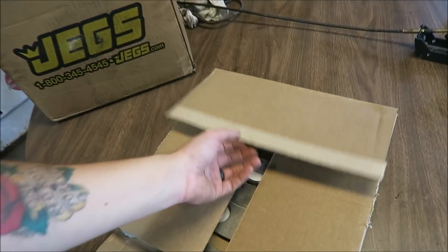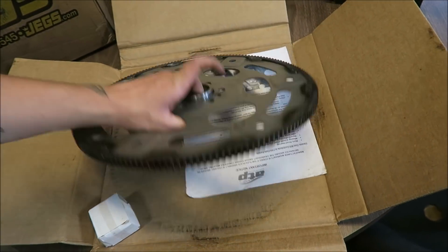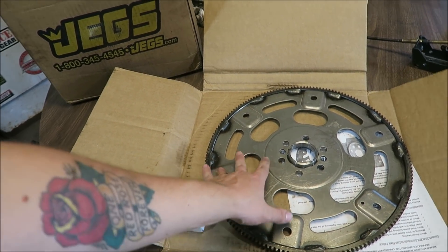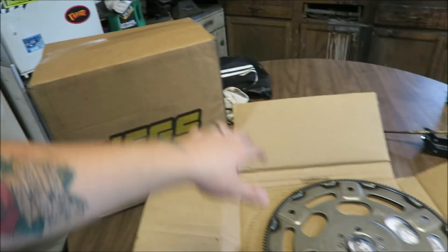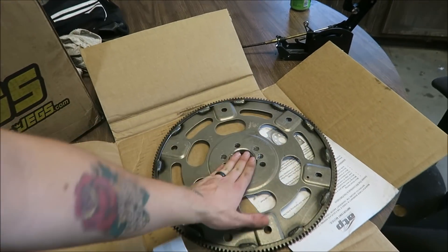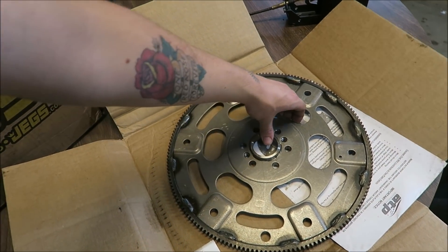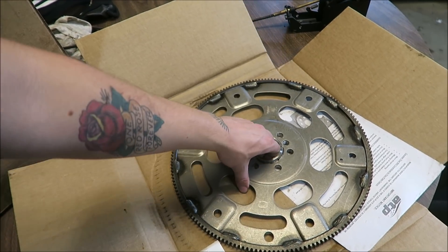Here is the magic sauce for all of it. You can mess around with spacers and expensive advanced adapters conversion flex plates for 180 bucks, but what my buddy Scott told me is: get a flex plate for a 2003 or so GMC Savanna van with the 6.0. They're like 60 bucks, they have the built-in spacer, this one came with the bolts, and it's drilled for Turbo 350 and Turbo 400 bolt spacing — it'll bolt right up. It's the same thing I did on the RX-7 and the LS-swapped Camaro. They're super cheap — I'll try to remember to put the link in the description, but it was like 60 or 70 bucks.